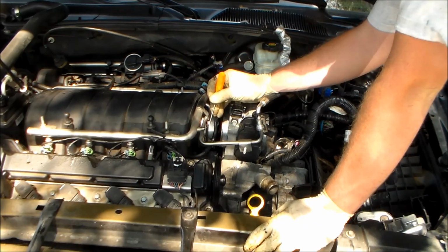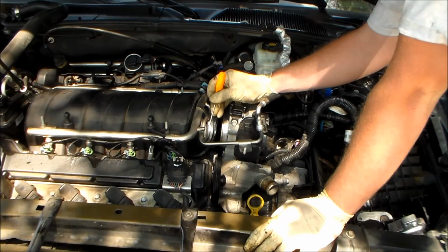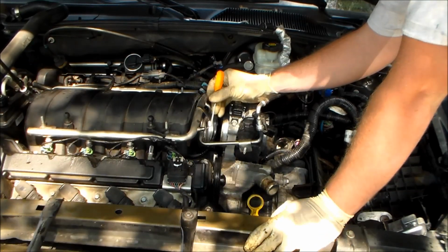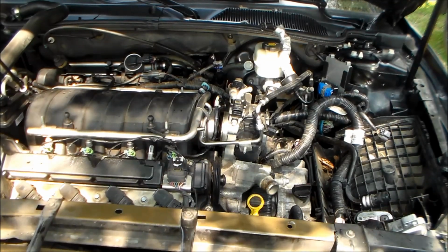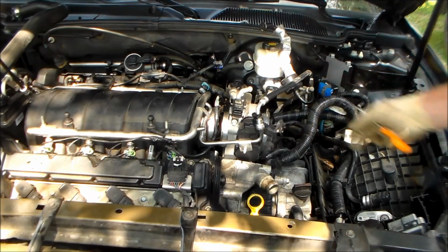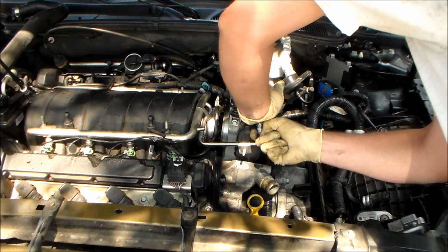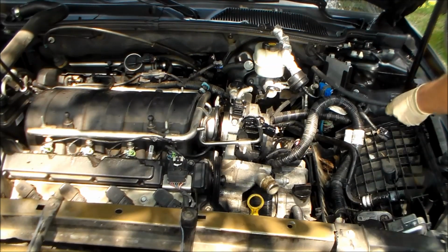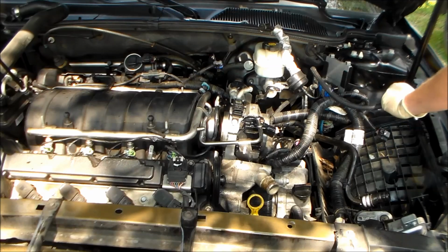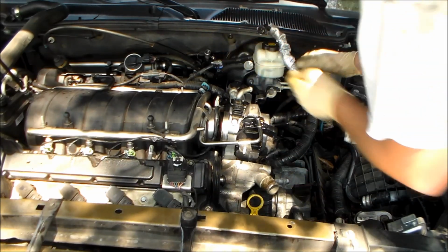First thing I'm going to do is let the fuel pressure out, as I'm sure it's pressurized. Do that with my little pick here, hopefully. You know, fuel pressure going. Pop the little retainer off. Fuel line. Press in, press off. There you go, that's out of the way. Actually, let's get that out of the way facing up somewhere so it's not dribbling all over. Nobody likes dribbling fuel, stinkies anyways.